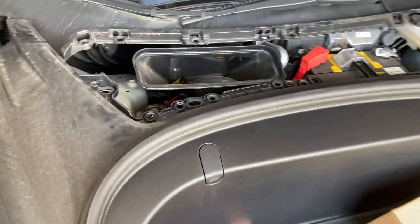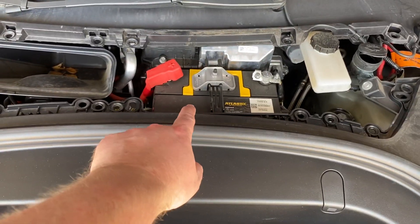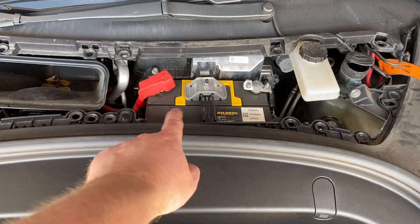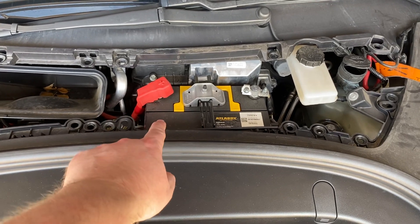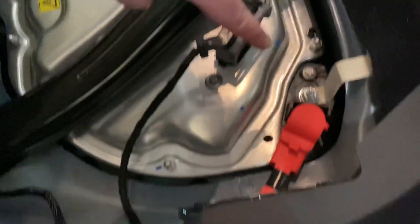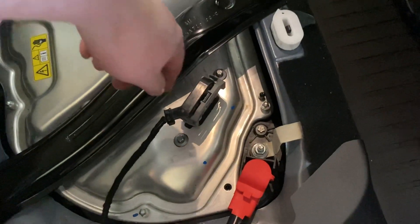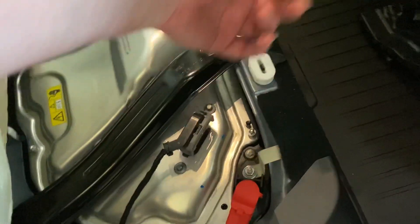Over here we have the Model 3 — I've got a 2000 watt inverter. Unfortunately, you're not able to do the same trick here; this battery is limited to somewhere between three and six amps and the recharge rate is actually much smaller than that. So the Model 3 will be a little trickier. I've already assembled some of it — you can see there is another battery pack here, which is another DC-DC converter we can plug into.